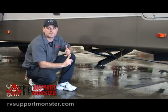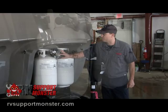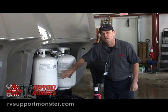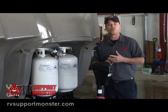We have two 30-pound LP tanks. The centerpiece is the regulator — that's going to point to the tank that you draw off initially. If the window is green, the tank still has something in it. If it's red, it's letting you know it's run out and switched over automatically. Behind this, we have a battery. You can run a lot of things off the battery like the slide outs and the furnace blower motor. If you have a powered awning, that'll run off the battery too. You can run just about everything off battery and propane except for an air conditioner, microwave, or anything that you plug in.